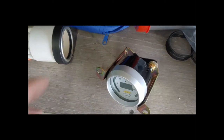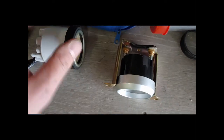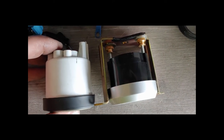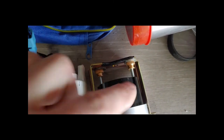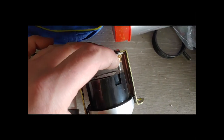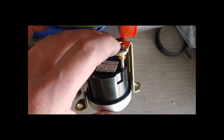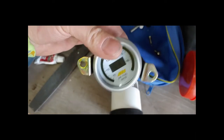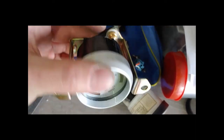Here is the gauge mounted in its pod. I wanted to make sure it was the same depth as the other gauge - naturally it wasn't. So I spun out the rear brass nuts that normally would hold it in from the backside so they were halfway exposed, then put a washer in there to make up for the difference and about a quarter inch screw with a lock washer through the back as I tightened it in. That brought it to the right spacing. It's nice and tight, doesn't wiggle, doesn't move.